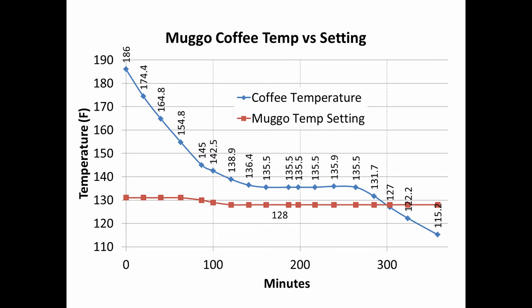You can see on the dark red line, which is the temperature I had the mug set to, I started out the test with it at 131 degrees, but before it even got down to 140 degrees, I could see that the mug was starting to turn on the heater — which you can see on this chart as a non-linearity of the blue line at around 145 degrees — which I knew was too soon.